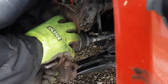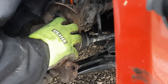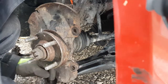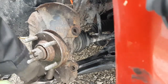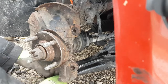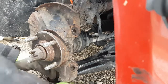And apparently it's not going to be that bad today. So I get this one started, this lower ball joint bolt, and I'm going to run it most of the way in. If I don't run it in, it'll hit the control arm when I turn this to get the other bolt in. Is it framed in? Yeah, you guys can see what I'm doing here. Oh, Stanley ratchets like to reverse on their own. Like that. Oh my God.